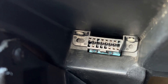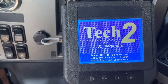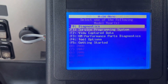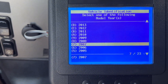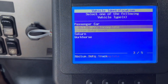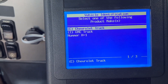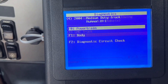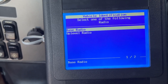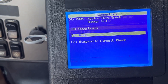Let's go down here — there is our OBD2 connector. It comes to the main splash screen. Hit enter. Now we're going to hit diagnostics. Select our year — this is a 2004. In 2004, it's going to be categorized under a medium duty truck, Hummer H1. You can check some things on your body, mainly radio it looks like. I think it just shows you voltage and your current radio settings if you still have the factory radio installed.